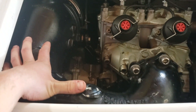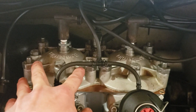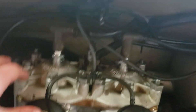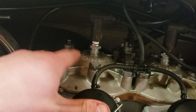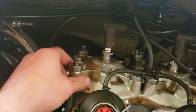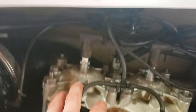After you've got the pipe off, you can pretty much start pulling the motor, or get into whatever you need to get to. The cylinder head is just held on by eight nuts and seven bolts. Bolts are 17mm, nuts are 22. It's pretty tight in here, so the way you can get these out and pull the head without actually having to pull the motor is when these studs get threaded out, put a pair of vice grips on them and get your 22 on there. You may need to put some heat on it with a blowtorch or heat gun. Just be careful, because if there's grease on everything it'd be very flammable.